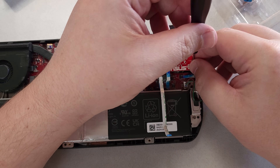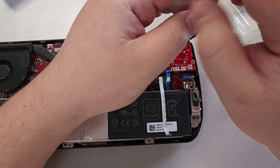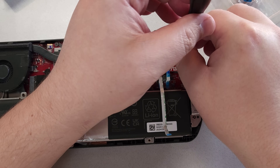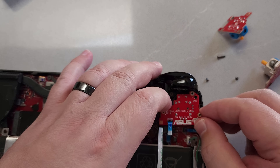Note that the back screw plate uses a Phillips zero screwdriver, but on the internal of the analog sticks it's going to be a Phillips triple zero — a smaller Phillips head. Use that bit for the analog sticks themselves. Once you remove those three screws, remember the placement of how they are, because the screw sizes will differ.